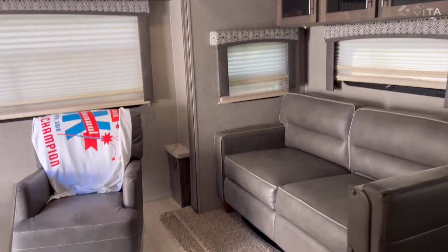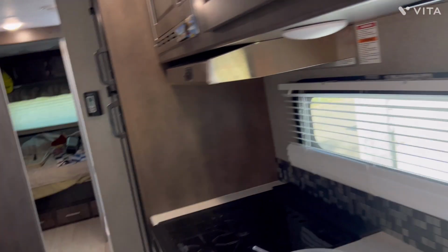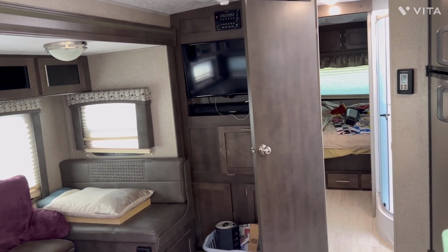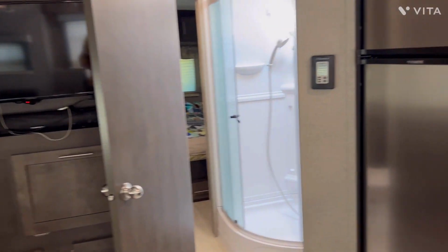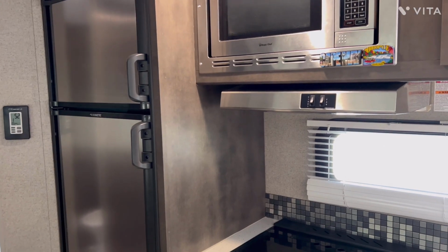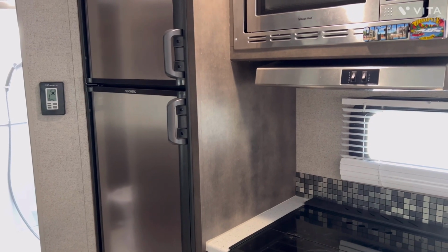Now I'll repeat this process 4 or 5 times. I'll let the compressor power itself up, get up to 100 PSI on the one side and 40, 42 on the other side. The big advantage of doing the winterization this way, as far as I'm concerned, is that if I want to leave in January or December or November, I just hook up my RV and go.